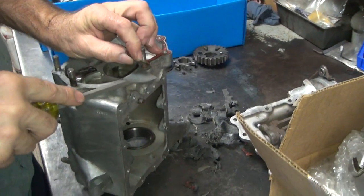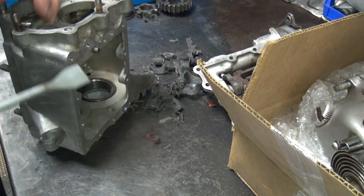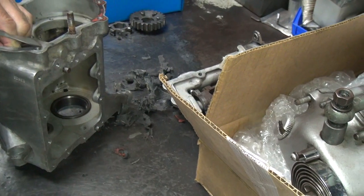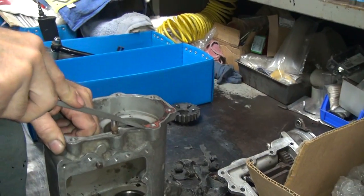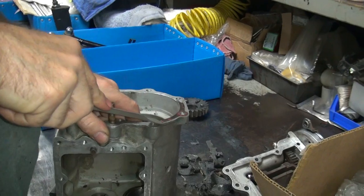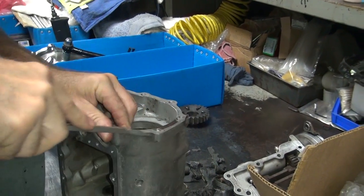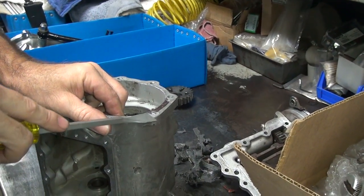See this one was too long so they cut it — same on that one. That means they didn't have the right stud. That stud's too long unless you've got a bunch of electric start crap on the bike. So I'm going to have to get a hold of the guy and see if he can run the electric start or kick all the way, because that will determine what studs you put in here. There's another bad hole — see how the threads all pulled up in the case.